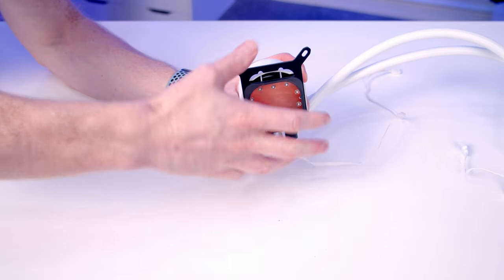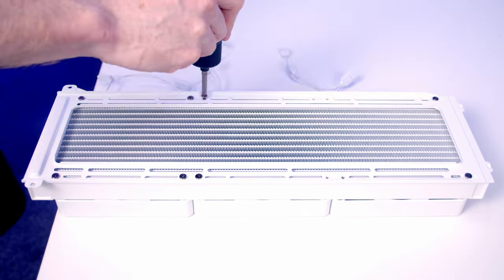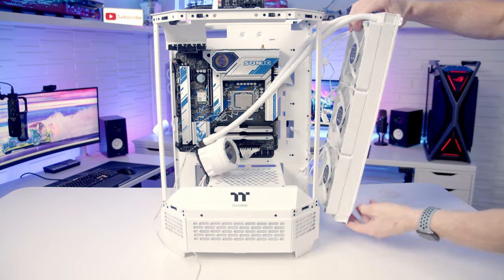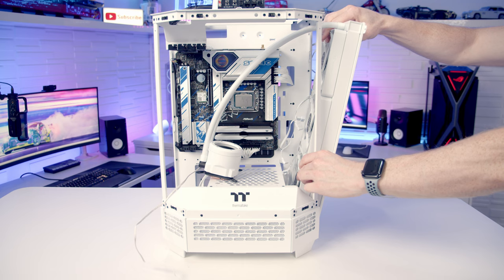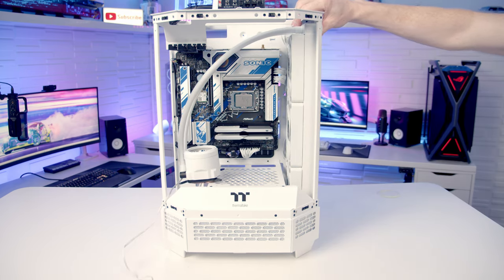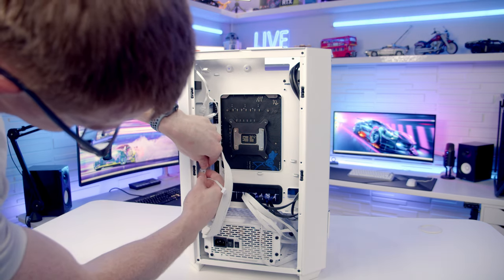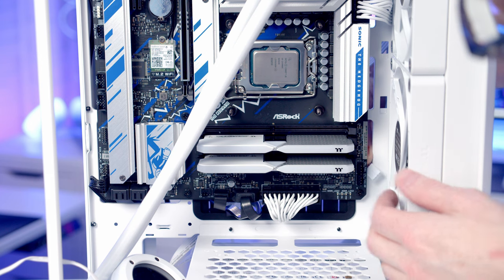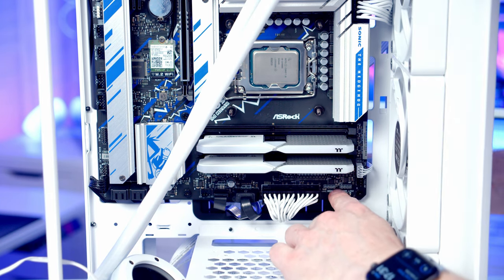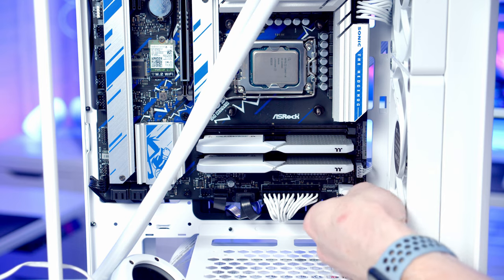For the pump we take the Intel bracket and slot it into place. Then we set the radiator bracket onto the AIO and use the short radiator screws that come with the AIO to secure it to the bracket. We set the AIO into the case, making sure all fan cables come through to the inside, then slot the AIO into the bracket at the bottom. Before securing it I'll pass the fan cables through to the back. Once all cables are pushed through, push the AIO up into place and secure it with the two screws removed earlier. At the back of the case daisy-chain the three PWM and three ARGB connectors together. Bring the PWM cable through to the CPU fan header and push into place. Bring the ARGB cable from the fans and radiator through to one of the ARGB headers and push into place. Pull all excess cable through to the back.